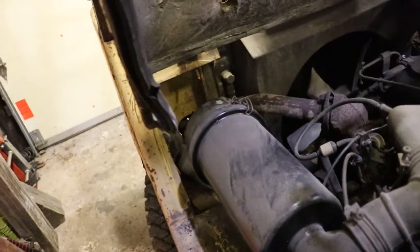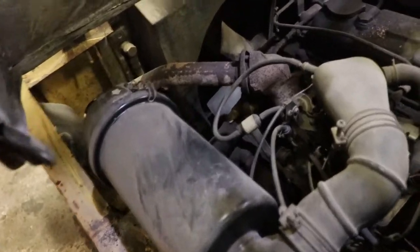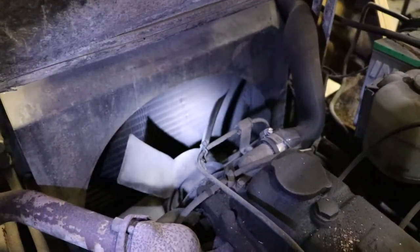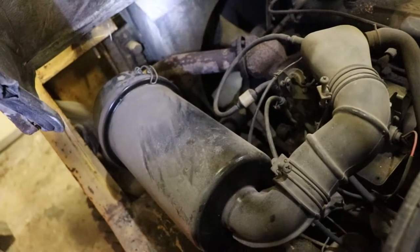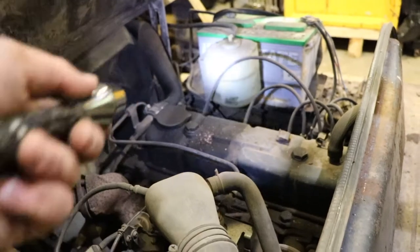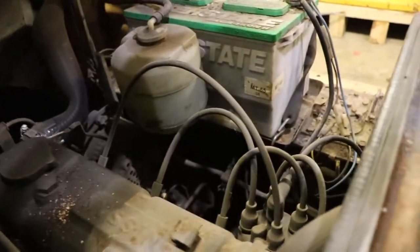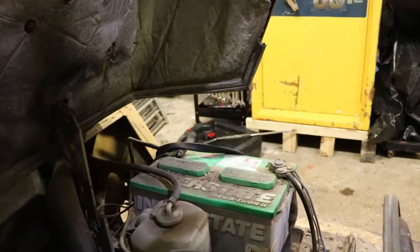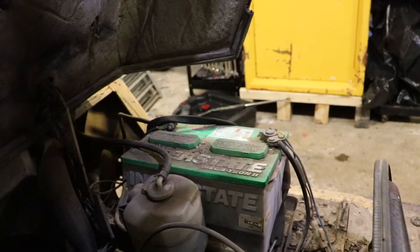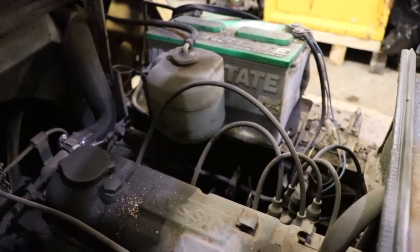Being Japanese I imagine everything is metric on it. It's got a decent air filter - a nice big filter like my six-liter van actually. It looks good, nothing bad going on in there. Radiator looks good but it's a little bit low, so the vacuum return hose isn't working. I'll have to replace that little hose, maybe the rad cap, and get that working again. There's a fuel filter down in that little pot. To get a drain pan under this thing I need to put a three-ton jack under it and lift it up, then put blocks under it.